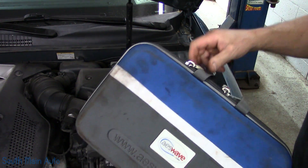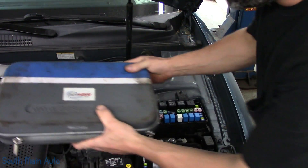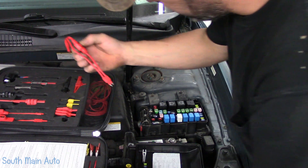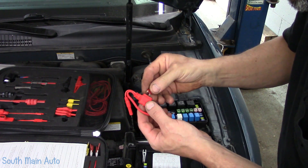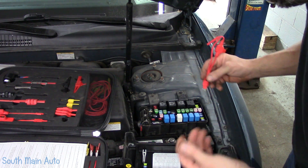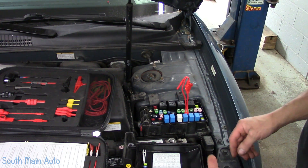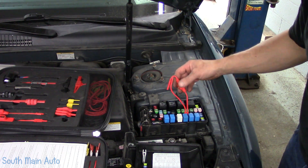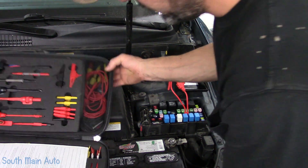Because the fuse takes some time to blow, we need to get a wiring diagram. We also need to be prepared — I grabbed a 10-amp fuse and we're going to stick it in this fuse loop. Now sometimes I'll run the amperage through my meter, but this is a 10-amp circuit and my meter is only rated at 10 amps, so we're going to use an inductive amp clamp instead. Let's get a diagram and see what this fuse runs.